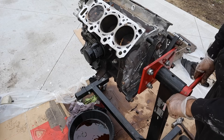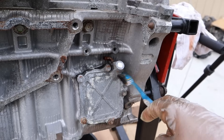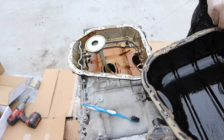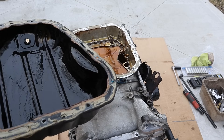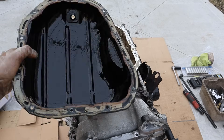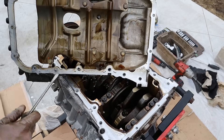Here is the coolant crossover pipe. Time to make some mess — there's oil in there too; I think they definitely overfilled the oil on this thing. To control the coolant mess, there is a drain plug on the block, and one more on the back side, but that axle usually gets in the way and it's hard to access. Next we're taking off the stamped steel oil pan — all 10mm bolts. It looks nice and clean. The oil pickup tube basically has nothing inside. I like the fact that this has a two-piece oil pan with the lower being stamped steel, unlike the J-series Hondas' big cast piece — if you go over something and it cracks, it's a big job to replace; at least this one is more durable and flexible. Now removing all the 12mm bolts that hold the upper oil pan together.